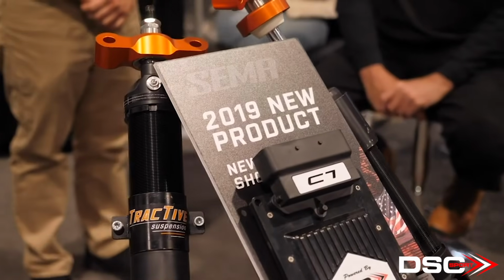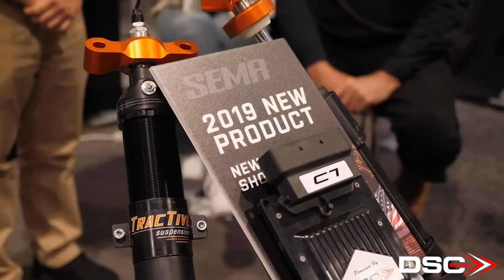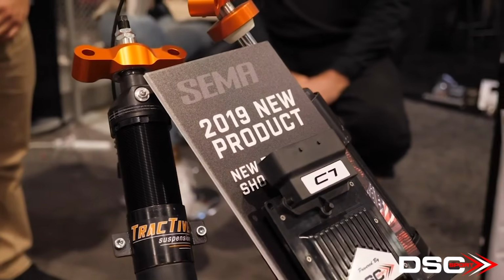It is very controllable. Well, first, this is a very advanced feature that we use. We don't expect every user to use it, but for those who actually need it and want to use it, in the velocity table that we have, once the ride height is zero, we can fill in a numeric value. So once it gets to a certain travel point, the electronic bump rubber will begin, which we would command the shocks to increase the damping force. And we can also have a ramp angle to ramp up the force so it's not so abrupt.